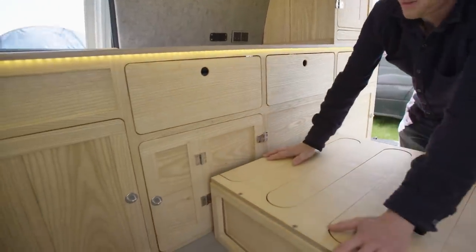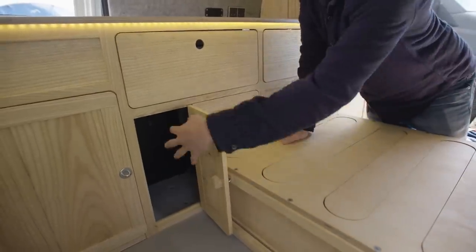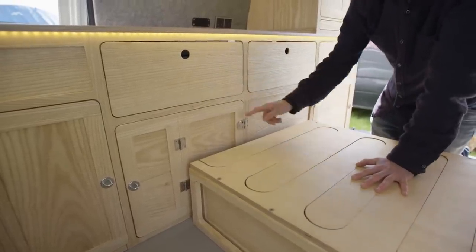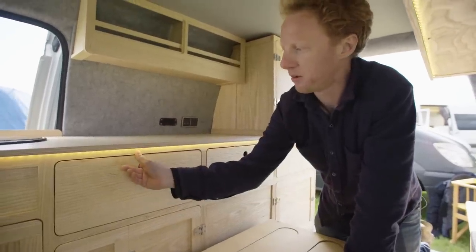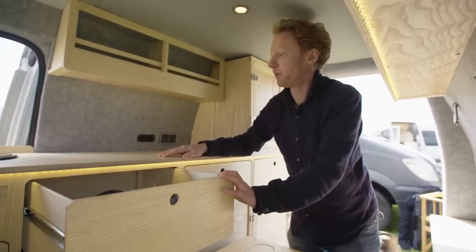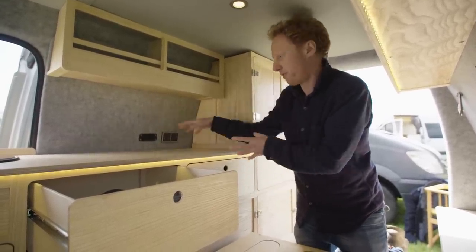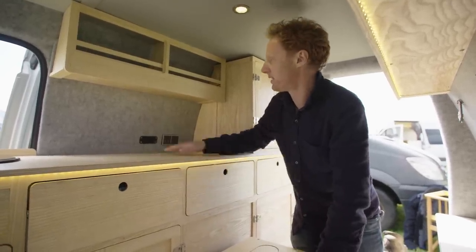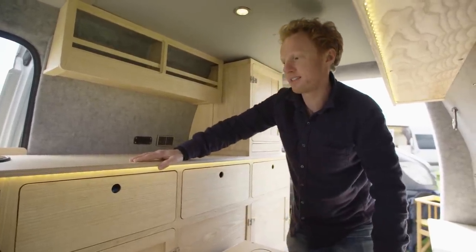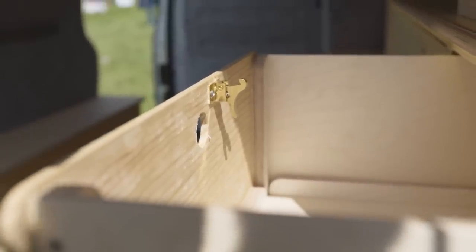This door here is a bit unique because it only opens halfway when you have the seat inside it. I wanted to have some access when the seat was in place, just so you can get things from that side of the van. But when the bench seat is either taken out or fixed in the rear position, you can obviously open this whole cupboard door out as well. The drawers are held in place by marine catches just there so that they don't swing out when you go around corners. They're also on runners that are supported by hanging from the surface itself rather than on the main frame, which allows me to make the frame a lot lighter. These are keyboard runners for computer keyboards, so they're held in place by quite strong fixings.